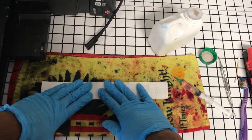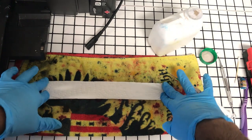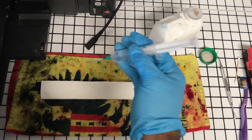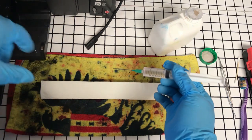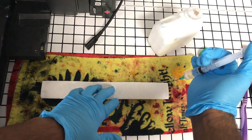And the reason we are going to fold this and apply the cleaning solution outside of the printer is that we don't generate a waste ink counter error. Because if you put the paper towel in first and try to add the cleaning solution, you may miss and hit the little pad that's underneath it. So it's probably good that I decided to stop and do this.